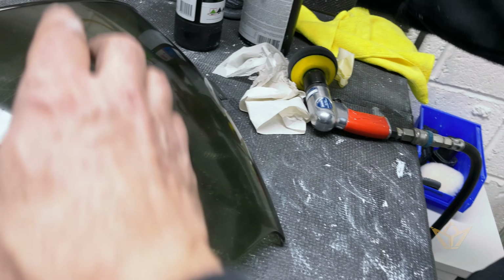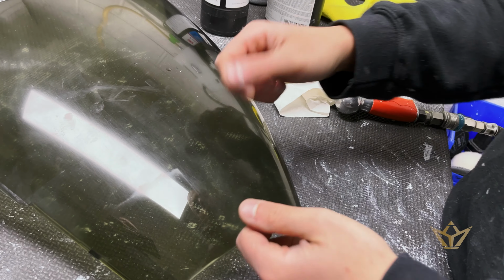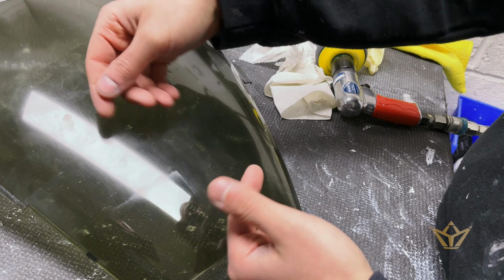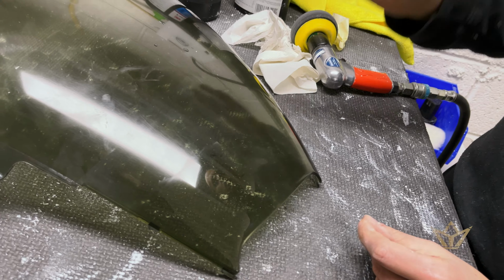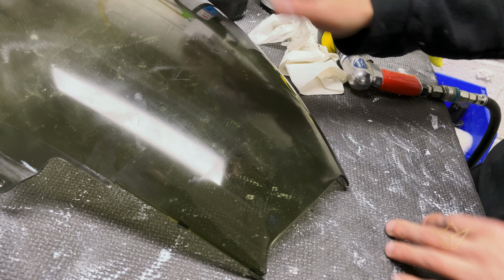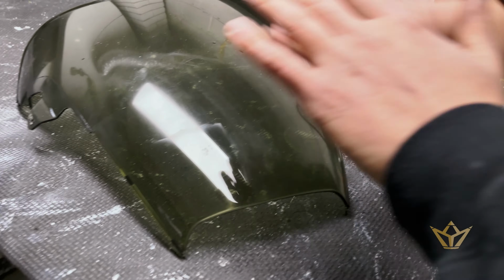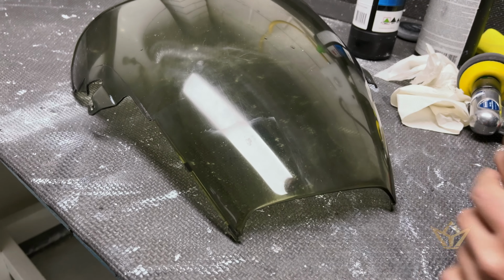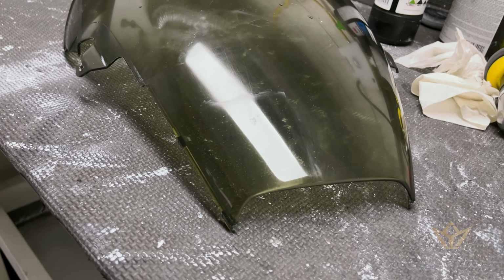Finish one square completely. And then even with the polishing and everything, you check that it's nice. Okay, then move to the other one, and you just blend it a little bit with the other one, and at the end, if you want to be 100% perfect, the only thing that you have to do is just take 3000, just key it one more time, all of it, and then just polish it a little bit, all of it. So then you will remove any line that you could see between the areas. Difference already. Good, okay.